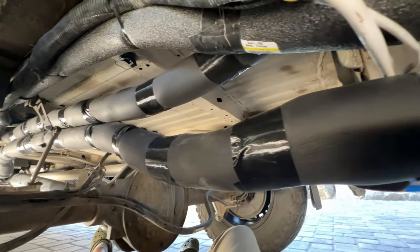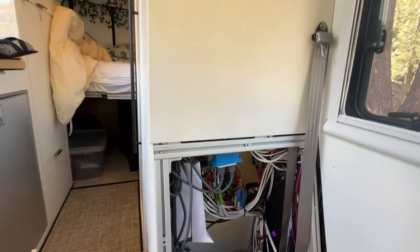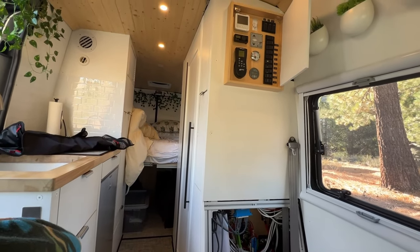If I were to do this build all over again I would run all of the pressurized freshwater pipes on the inside of the van and only run the minimum possible piping on the outside — basically just the gray water lines that need to drain downwards. The 12-volt heat tape taps out at around 70 degrees in my testing, and once it hits 70 degrees it stays on and uses a lot of amperage, so I added a heat controller at the start of the circuit with a temperature sensor so that when the pipes get hot enough the electricity to the heat tape turns off.